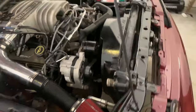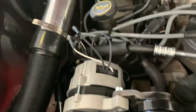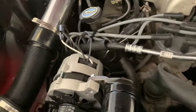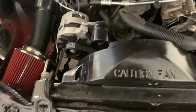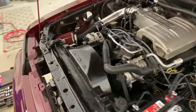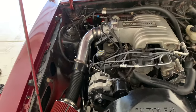Anyways, got the alternator in there — looks brand new, because it is brand new. Got the wires on there, so I need a heat gun or I'm going to use my wife's blow dryer to get that shrink wrap on. So we're gonna do that, then I gotta pop the radiator hose back on — I pulled it off to give myself more room to work. Since I added that throttle body, it's been giving a loud whistle — you can tell it's breathing a lot better, and the throttle response is a lot more on point.